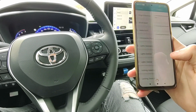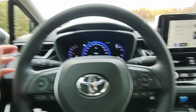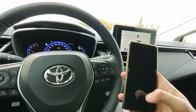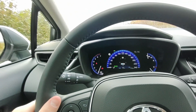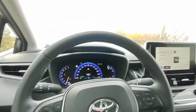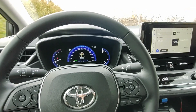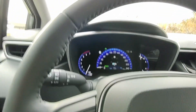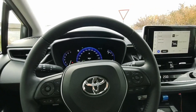Now let's go to lights. Here you can change the number of flashes for the turn signal. Right now it is set to 3 flashes — so if I press the stalk we get 1, 2, 3. I think I will set it to 4, which will probably be better. You can go up to 7 but 4 will be enough. Let's try it now: 1, 2, 3, 4. And I'll also test the seatbelt — see, now I am over 20 and there is no beeping. The warning is turned off. The dashboard light for the seatbelt is still blinking, but that doesn't bother me that much. At least I got rid of the annoying beeping.